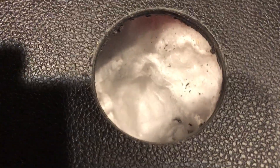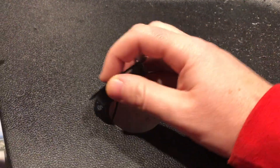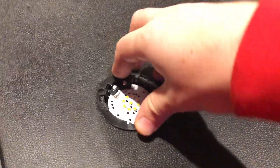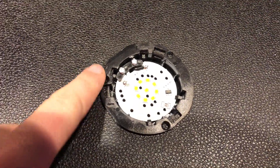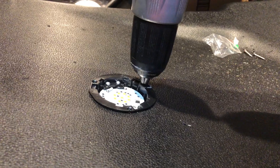Here's the first hole drilled right there. Just watch the insulation on the back — it will tear if you don't move that out of the way first. You take the wire, put the wire in first. These have little tabs on them so it actually locks right in there — pop it in and now it will not come out at all. Then we'll use the screws that are provided to screw into the three screw holes here.